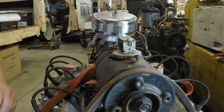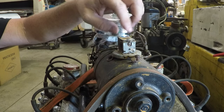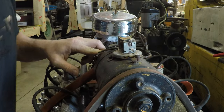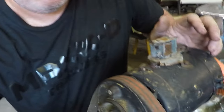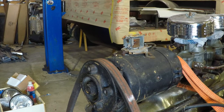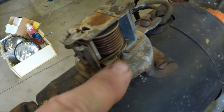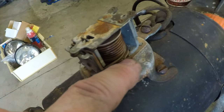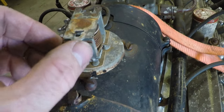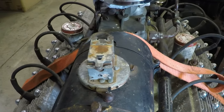Once you get those tacks ground off and pop that cover off, it's going to look just like that — same coil, contact there. It's also got another little tiny wire on the side there which is hard to see — sometimes those will come undone and that needs to be connected at that solder joint. There's another one on the front that needs to be connected too. Those are pretty straightforward — just clean them up with some 400 or 600 grit sandpaper.